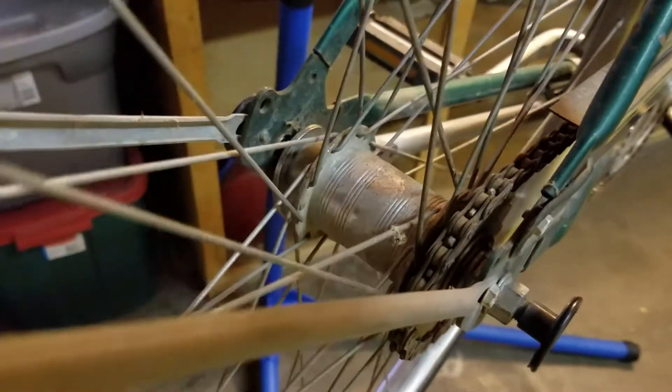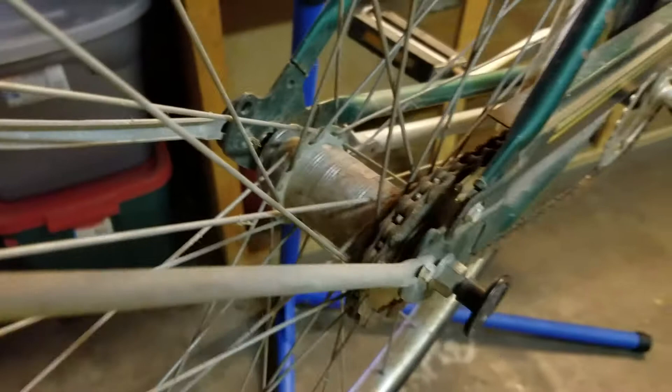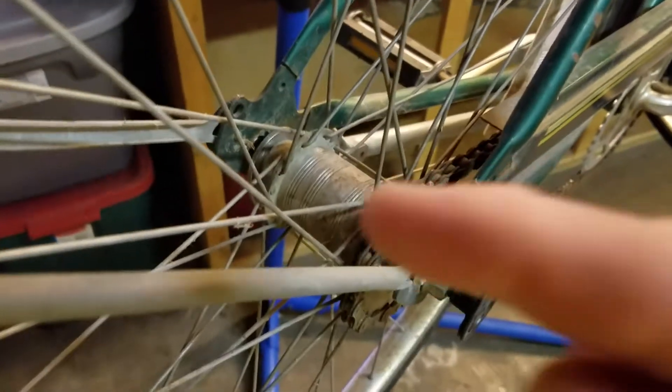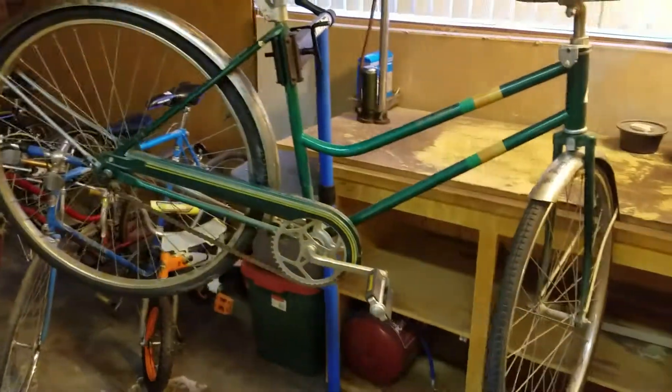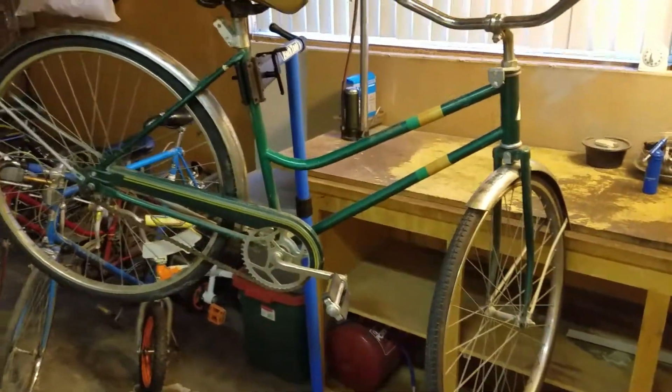Here's how that works: the tire is spinning, the rider pedals backwards, and in theory there are plates inside that hub. Those plates shift inward and squeeze down, and it brings the wheel to a stop. Now of course you're talking about metal plates sliding across metal components, and over time it wears out.